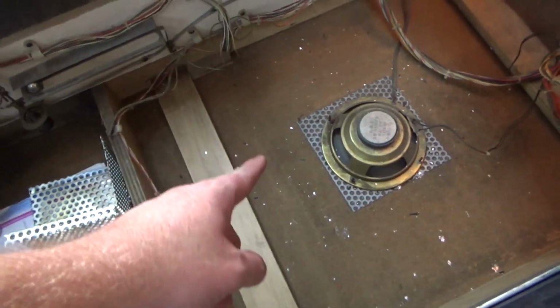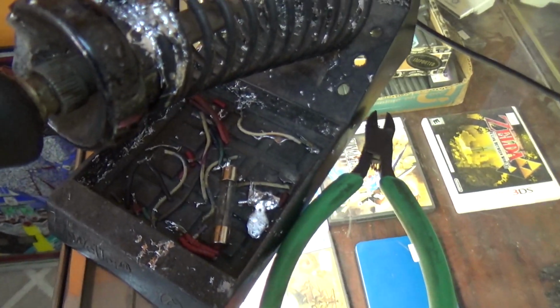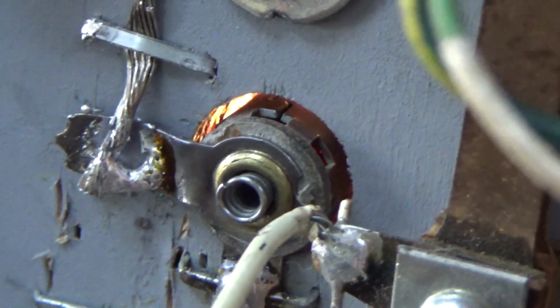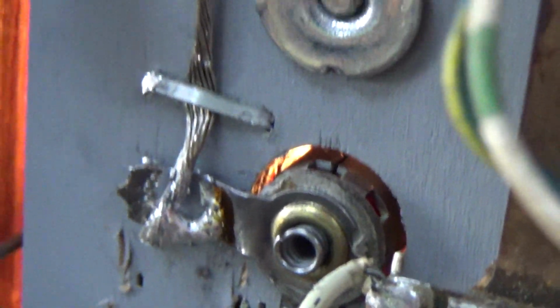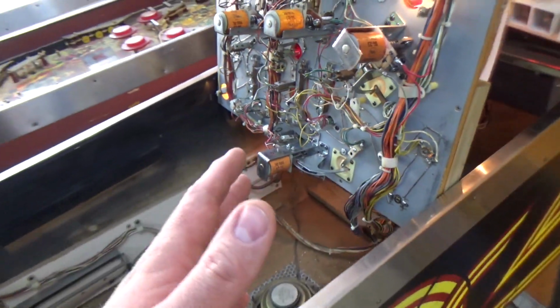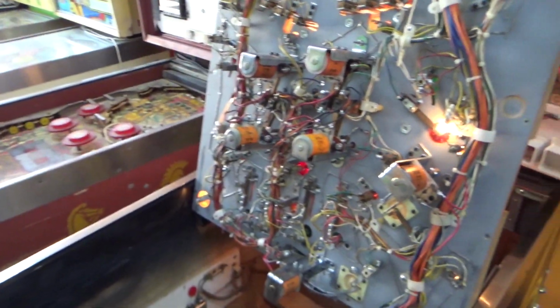There's stuff all over the place. All this. I've cleaned this up and thrown it away about 5 times already. So you just end up with all kinds of junk. Like, look at this. Ugh. Right. And so way down behind that bulb was a little piece of one of those staples that came loose from somewhere, got lodged behind there, and was shorting both sides of it together. But apparently, only after it got knocked loose from up here somewhere. So, but we finally found it.